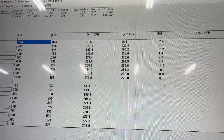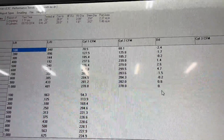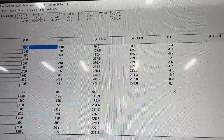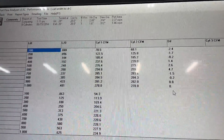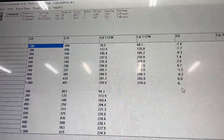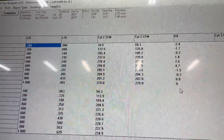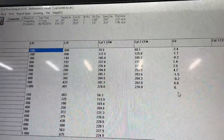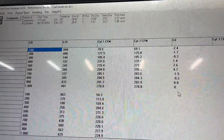Some of you might wonder if these numbers are within the margin of error. This bench holds things pretty close. The way I take a flow test: when I press record, the computer program takes 20 readings and averages them. What you see on the chart is the average of those 20 numbers. Power fluctuations and other variables can cause drift of maybe one or two CFM — this keeps it pretty consistent.